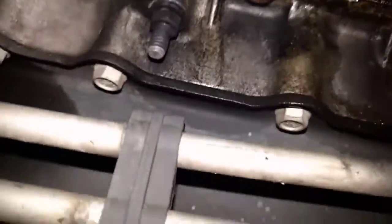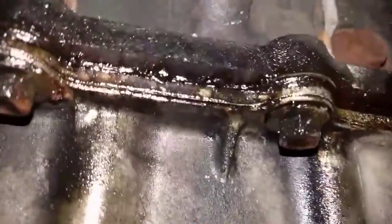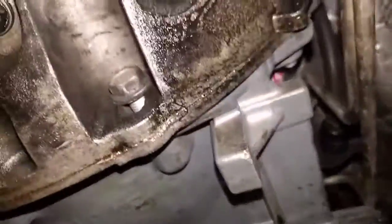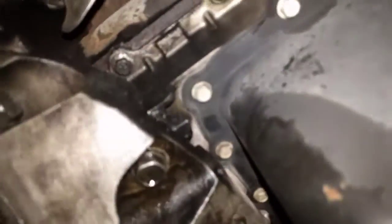Here's where I got the oil — right here, all up in here, right around the seal. There's tons of it, you can see it's just gooped up. I'm hoping that's where it's leaking from. I got oil down here on the bell housing, a little bit on this side — you can see up there. I'm thinking it's just leaking out of this gasket up here, because I can see all around that area.